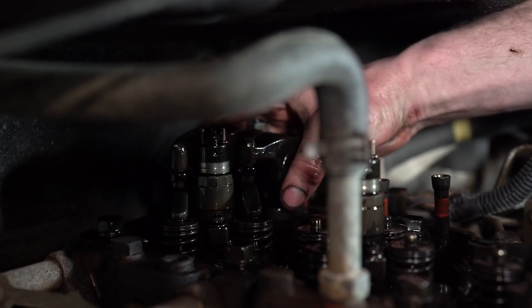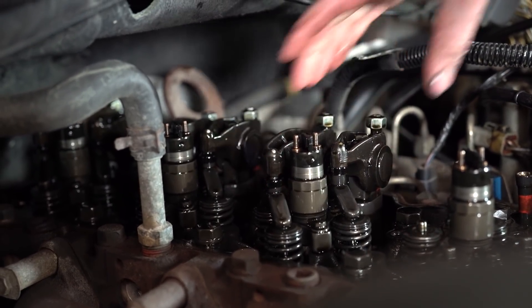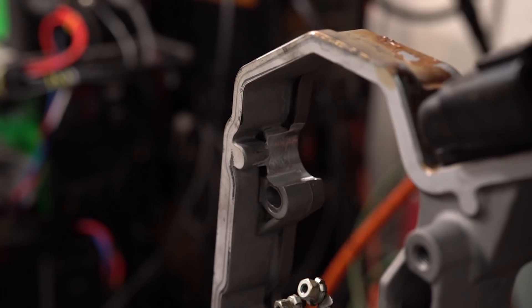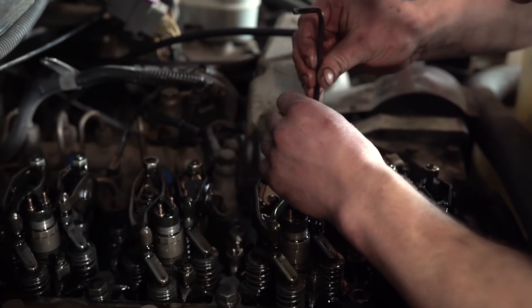Now we're going to put the engine back together the same way it came apart. Be sure to re-torque the rocker pedestals when you're putting them in — we like to put them at 27 foot-pounds. Some guys will creep them up around 30 foot-pounds for a little extra stretch on that factory fastener, but 27 is sufficient for most trucks. One thing that's important every time you do head studs: there is a little shelf on the back of the aluminum rocker box that holds all your injector harnesses, and it will hit on a stud. A stud has a nut, a washer, and a couple threads sticking up above it, so it will hit that shelf. We're going to take a die grinder and make just a little bit of clearance for that back stud on number six. Also, make sure you set the valve lash — these studs clamp a lot harder than head bolts and will suck the head down tighter, so your valve lash will tighten up.